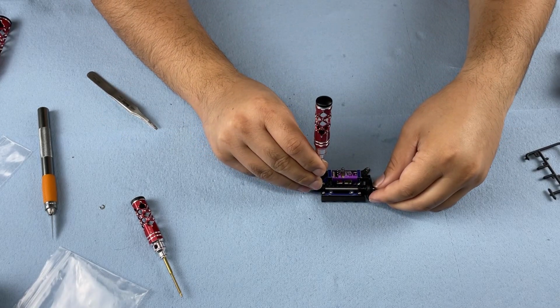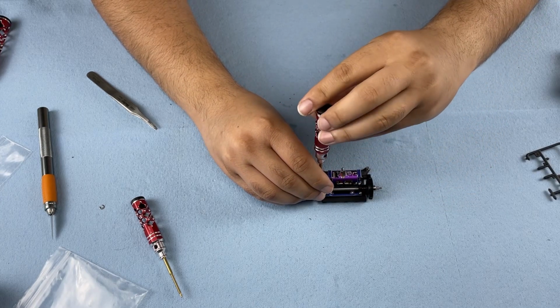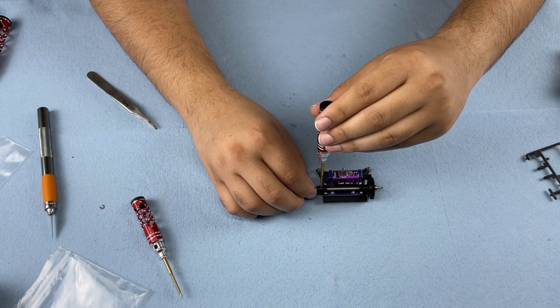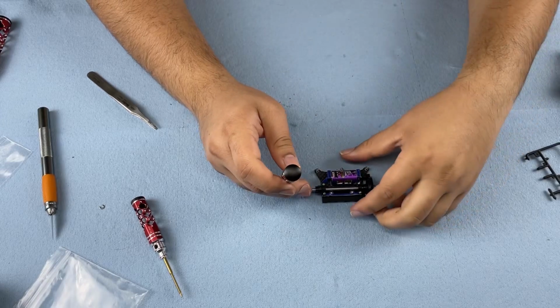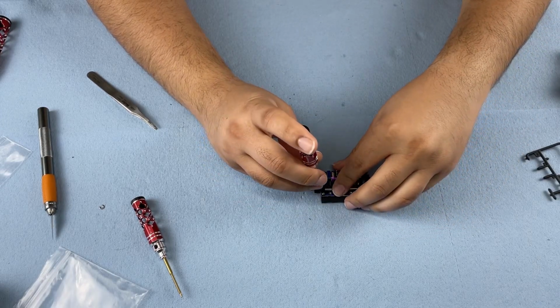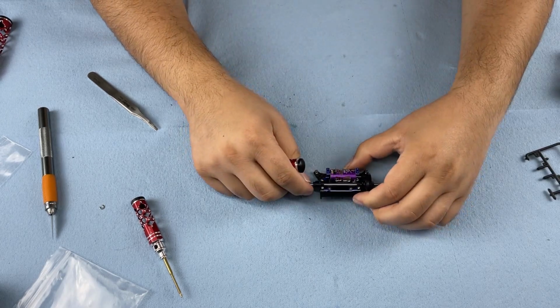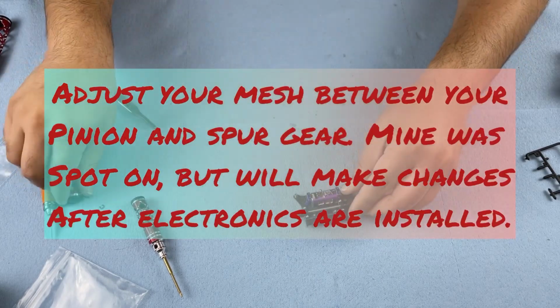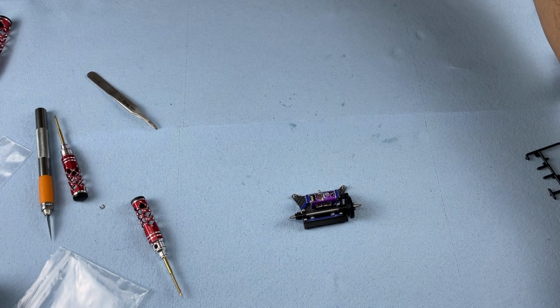And when you install this, you want to make sure that there's about 1 millimeter of side-to-side play. Otherwise, when everything heats up when you run, you can cause the bearings to start binding up. So I'm happy with that much side-to-side play. Okay. So there we go, that's the rear pod. So that's step 8, or page 11, and the second half of page 11 and page 12.